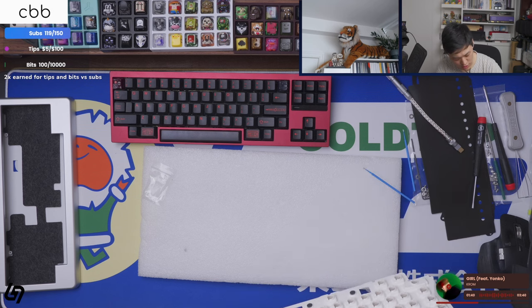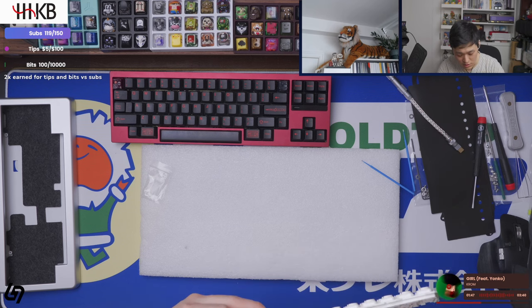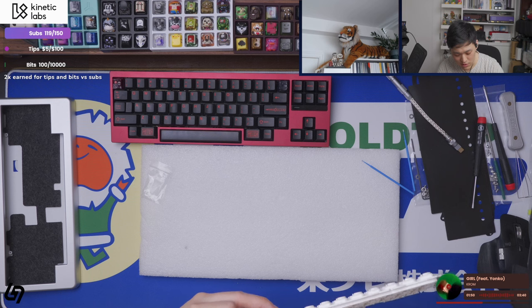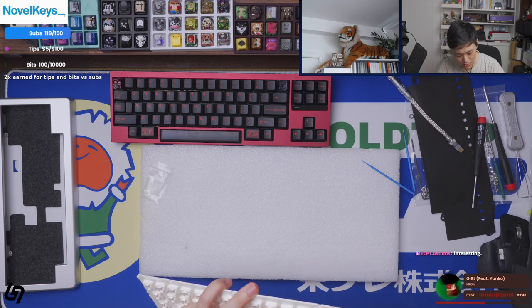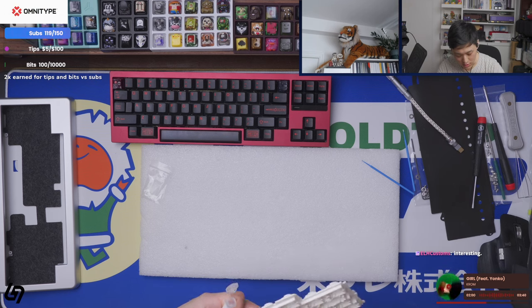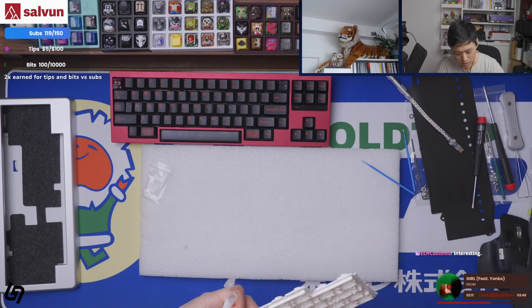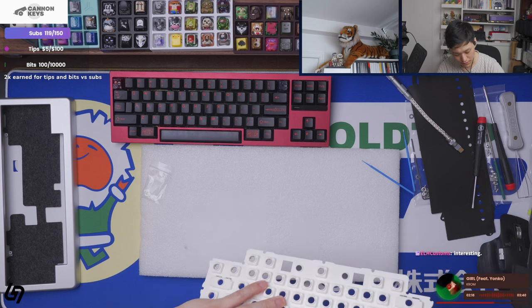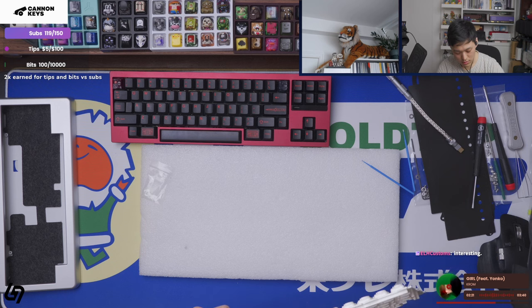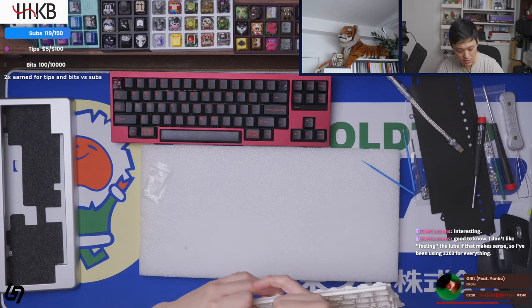As for a description, it's kind of hard to say because it depends on how much you apply onto the surface, how viscous it might feel. But assuming you're trying to be as uniform as possible, I would say 3203 is on the verge of just barely applying grease onto that particular switch or whatever it might be. It is much more subtle than applying 204 or 205. With 204 and 205, I think you can feel the butteriness, but 203 is a bit more subtle than that, assuming you're applying a small amount and trying to be as uniform as possible.